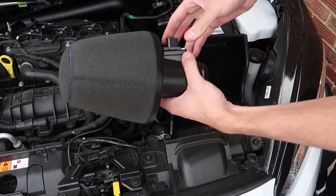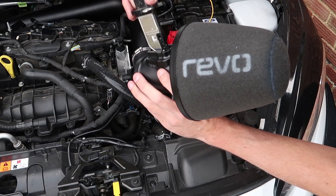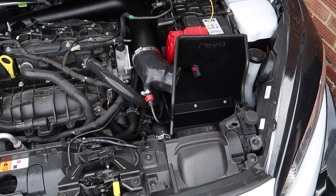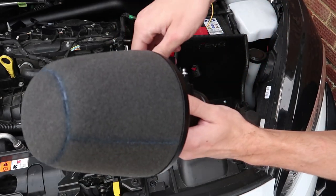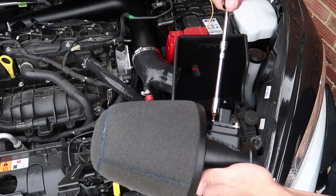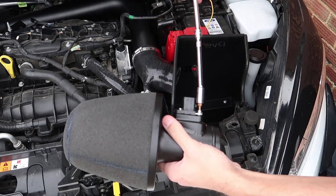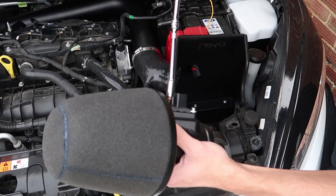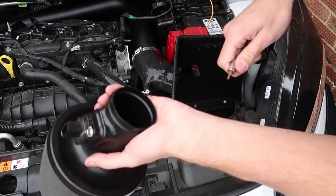What you're going to do is get your filter here, slide the MAF sensor in — the sensor is at the front — slide it in nice and tight, and then put some little bolts in here. They do supply you with the little bolts and washers to go in here. Make sure they're tightened down nice and evenly. Tighten these down — obviously don't over-stress it. They'll pretty much max out when it's tight — you'll feel it — don't over-tighten those, it's not worth it.